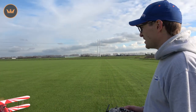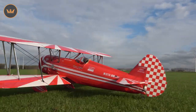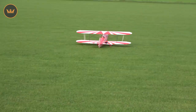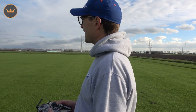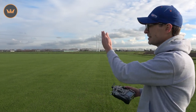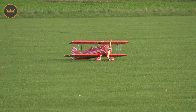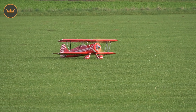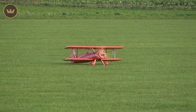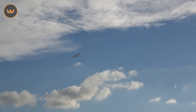A note on the setup: I've got a 60 amp controller, and on this 15-6 I'm getting just under 48 or 49 amps, and around 1150 to 1200 watts. It's a pretty good power-to-weight ratio and you'll see the performance is there - certainly more than scale. I'll try the 15-8 if I get the opportunity. Going straight into takeoff: holding a little bit of up elevator on low rates, letting the tail start flying first, correcting on rudder, then easing off the elevator, slowly applying power - and away she goes. That is a half-throttle climb away.